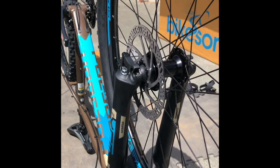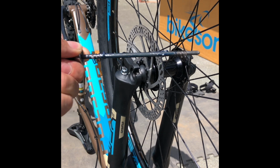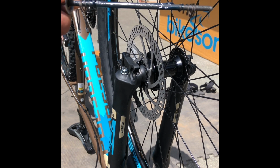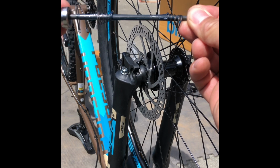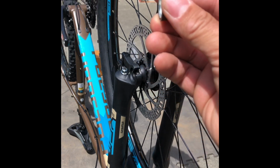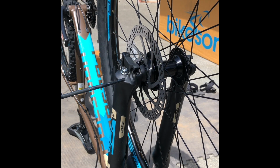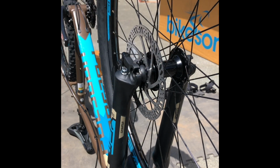And then what I was told to do by a friend of mine who builds bikes is, here is the front axle. So I'll show you this part real quick. So here's the axle piece, and I put a little bit of marine grease on there. It's waterproof, it's metal, so that grease is gonna help protect it and keep it from rusting. So it's got these two little springs on here. So I don't know if you guys see those. Yeah, there we go. So be sure you take one of those off on the opposite side where this piece is, so it just unthreads. Take that off just like that, and then it'll slide through. And so when you slide them through, usually the quick release part goes on the opposite side, so it's going to go this way in the bike actually.